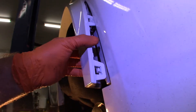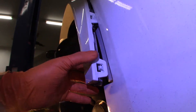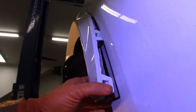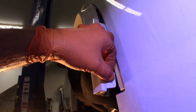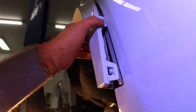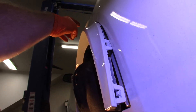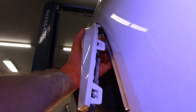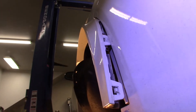Looking up from the rear of the car, this is the trim piece. This has got the M aerodynamic package on it and the M trim package, so these pieces may be slightly different than what you have. These trim pieces — I showed you on the back this little nipple, this little whatever sticking out here — you've got to hold that very carefully. You push that down from the other side using some of your trim tools, push it down, and slide it out gently, each one of these. There are three of them — I think five total. Once you get to this point and you've managed to get it out, you have access right there where my finger is — there's a screw. That's your access to get this back bumper cover off.